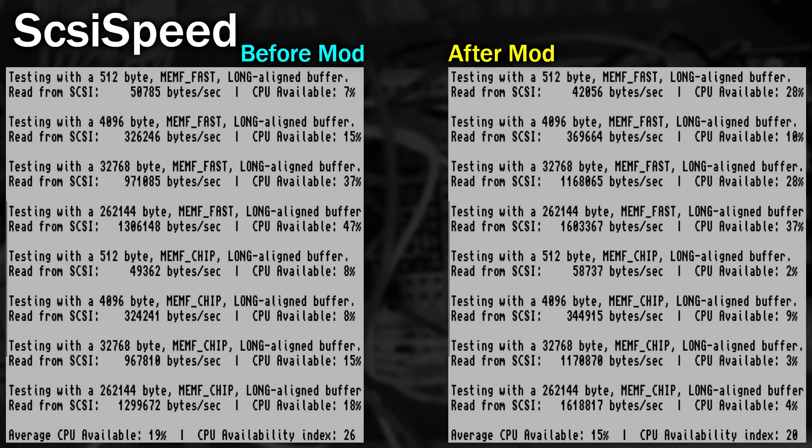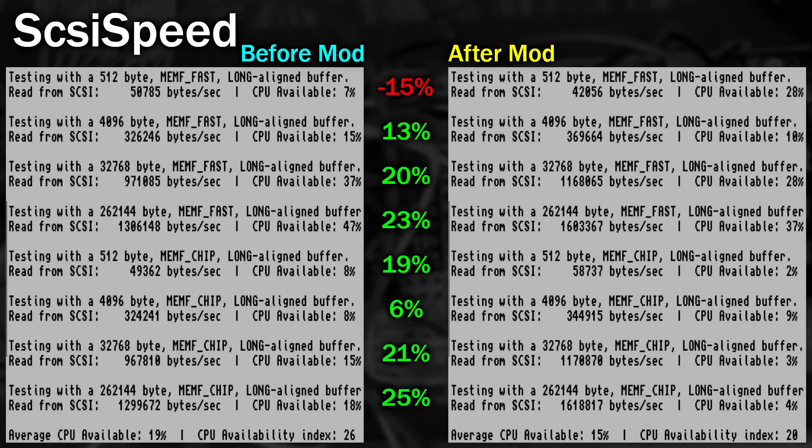Finally on to disk speed — SCSI speed — and there's a lot of results to look through here. On the whole, there's approximately a 20%-ish speed increase, although for very small transfers it actually looks slower. Again, it's worth noting that the CPU is now being used more due to the increased speed. Well, seems like it worked quite well. Now I know there are some tools on the Amiga side you can use to tweak this, for example the size of the data transfer to free up some of the CPU time, as well as controlling things like the asynchronous mode, but that's another video in itself. I also don't know if long term this would cause damage or corruption to any of the data, but so far it seems ok.